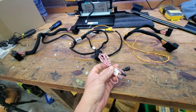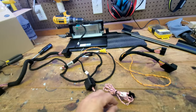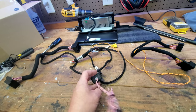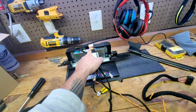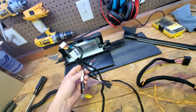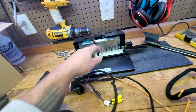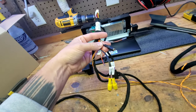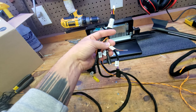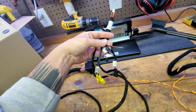These wires are supposed to go into the center speaker — I think they're for little alarms from the unit. I'm not going to wire those up, I'll just leave them bundled. This piece here plugs into the back of the actual unit and connects everything else. This MMI plug is important — it will plug into the corresponding port on the back of the unit. Everything else bundled here is for extra cameras and aftermarket accessories we don't need. I'll zip tie those off to keep things clean.